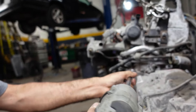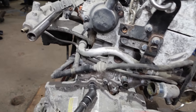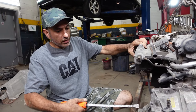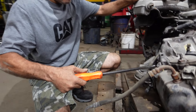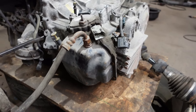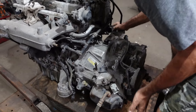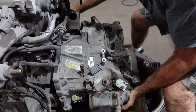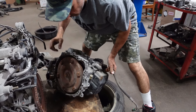I'm going to remove the top bolts — there are two top bolts. As you can see, the transmission already moved and opened. So we're going to use the pry bar to equally pry on each side, gently and slowly from each side, and we're going to remove the transmission. We pry a little bit from here and split the transmission.